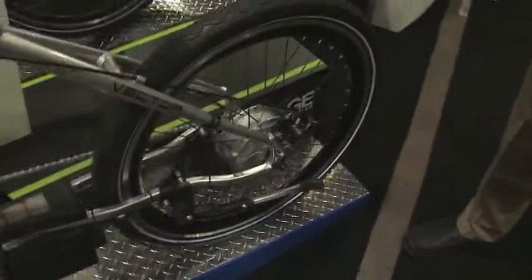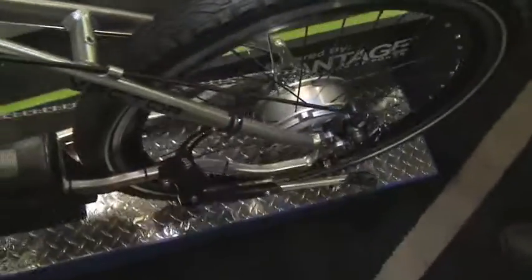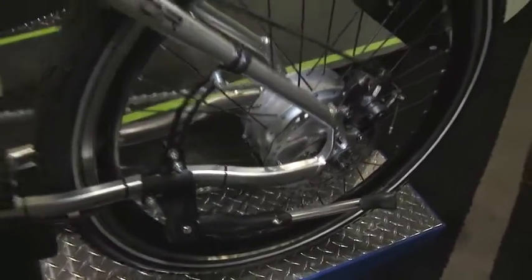We talked a little bit about the motor earlier — how many watts? It's a 450-watt motor. What we did is we actually designed the entire system ourselves. We build the motor ourselves, the controller ourselves, anything that's electrical ourselves. Our motor actually has what's called duo drive — two motors in our motor, basically. One aspect gives you speed and efficiency on flat terrain, but when you need the hill climb or want to go faster, the second coil — the second winding — kicks in and gives you that power.